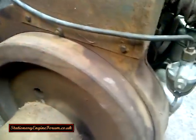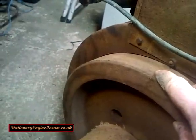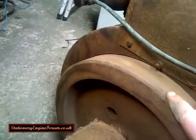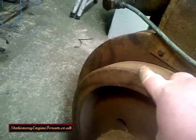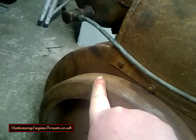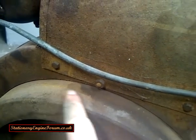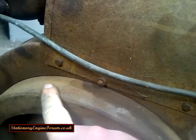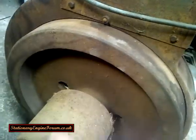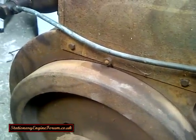Now when the engine is running at speed you won't hear that magneto click, but that top dead centre will come a little bit earlier. As the engine spins round, it will actually click somewhere around about a couple of inches before — and you work that out with degrees on the flywheel, which is what the handbook tells you about where the spark timing should be.